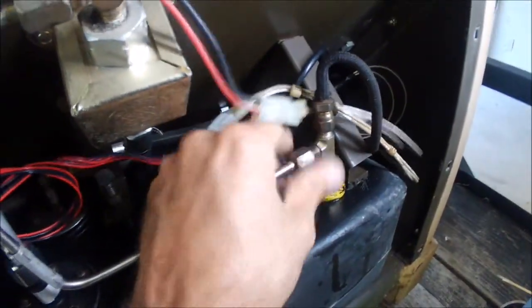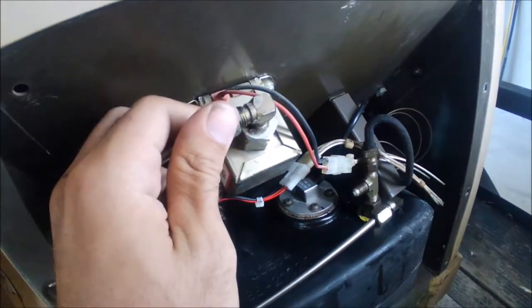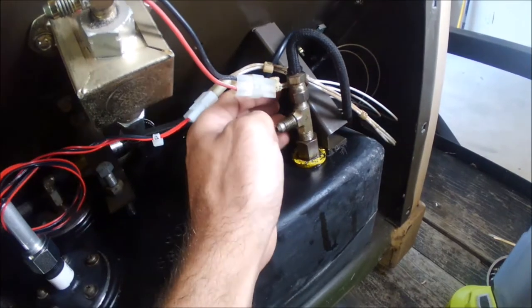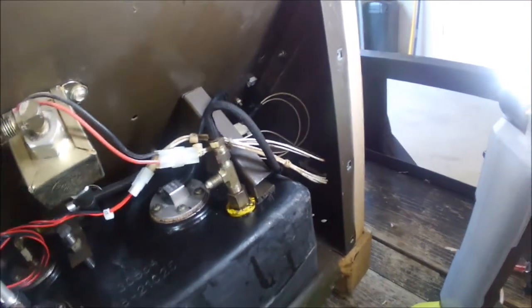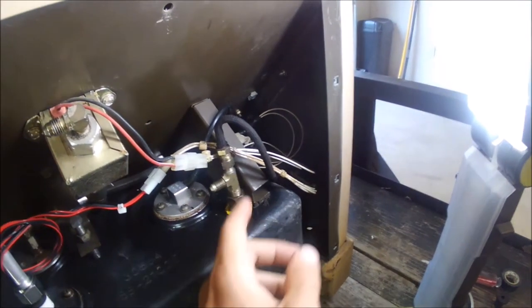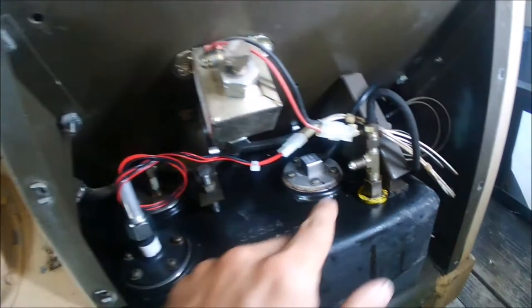To replace this nut, I'm going to start by taking this fuel line off — this comes from your auxiliary pump. Pretty much any work in here, it's great to take this off to get it out of the way. The next thing to loosen is this line that returns from your high-pressure injection pump. When you have the switch up front on prime and run and you hear tick tick tick tick, you can let that go and that pump's just going to draw fuel out of your inlet or from your auxiliary pump depending on how you're running.